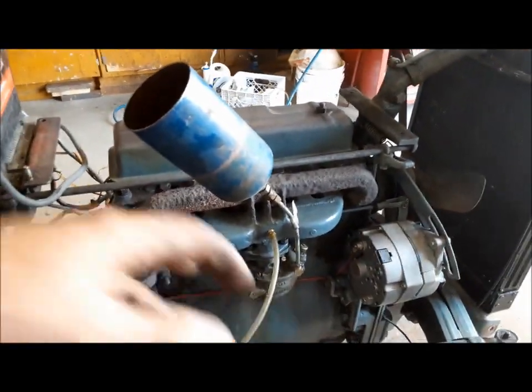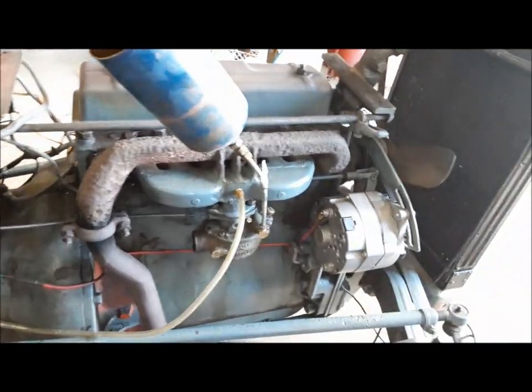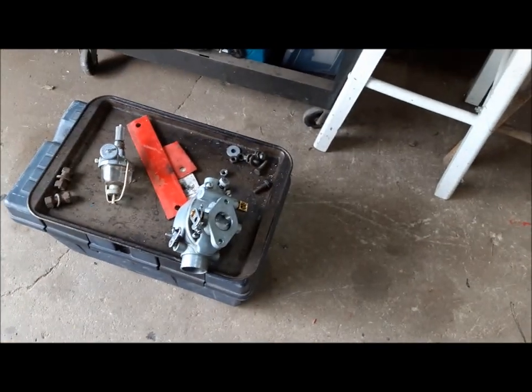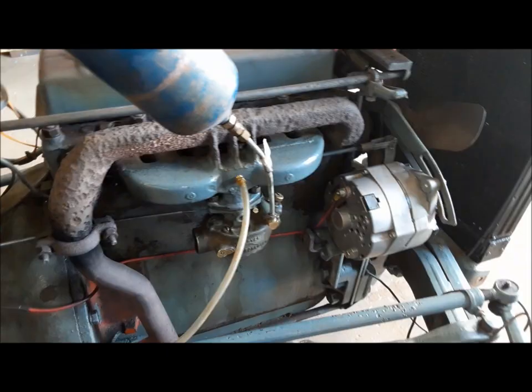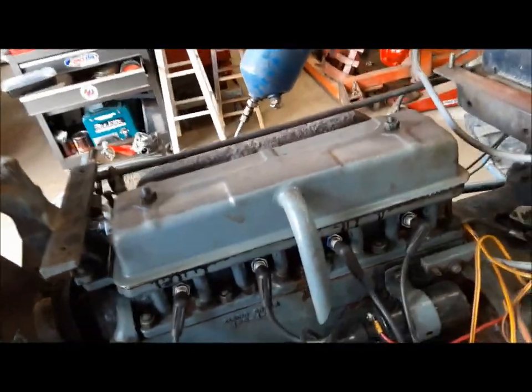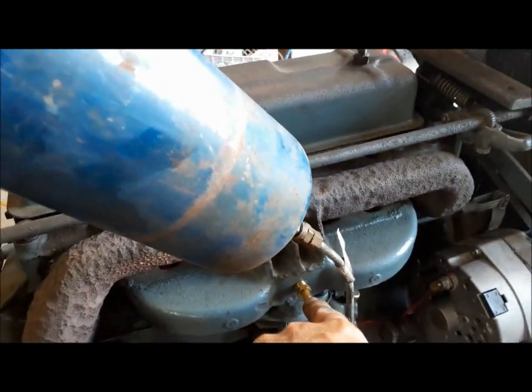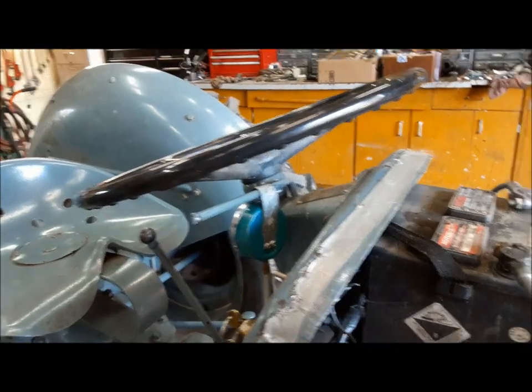What I've done now — I've removed the fuel tank, I've removed the air cleaner, so anything outside of the engine on this side has been eliminated as a possible cause. I took off the aftermarket carburetor — I've never had any luck with them at all — and put the original one back on. We've got fresh fuel in there. While I was at it, I took the spark plugs out. They're clean. I gave it a compression test — it's got 120 in every hole, so that's good. I drilled and tapped for one-eighth pipe in the intake manifold and put on a vacuum gauge.